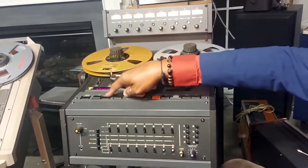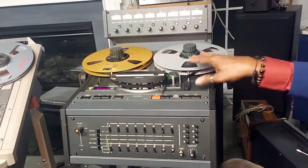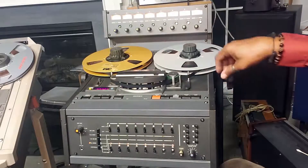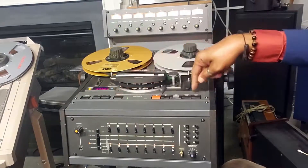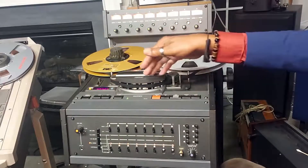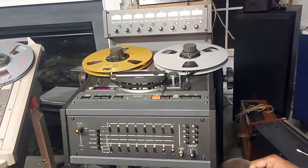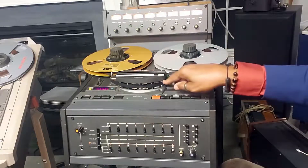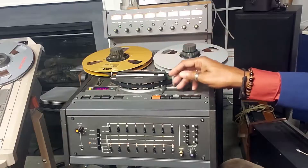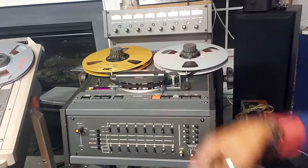This is for large and small reels. This is your edit button. If you're playing a tape and you want to cut part of the tape out, when you press the edit button and press play, the capstan will engage with the pinch roller. The tape will spill out, but it won't be taken up by the take-up reel. It'll spill out until it reaches the point where you want to cut off that piece of tape. Press stop, and when you press stop, that disengages the edit button.